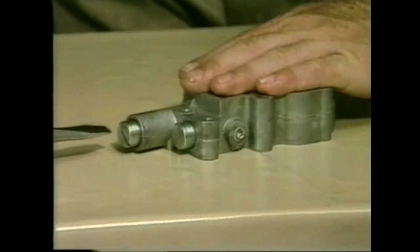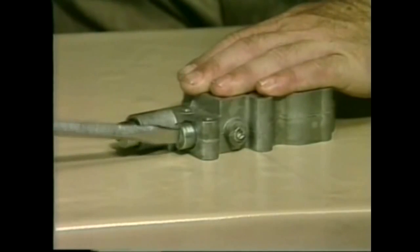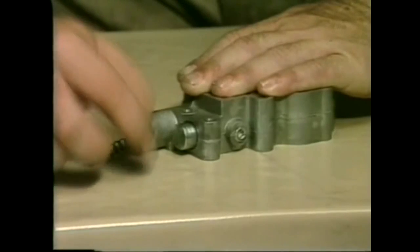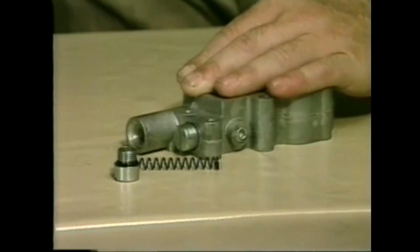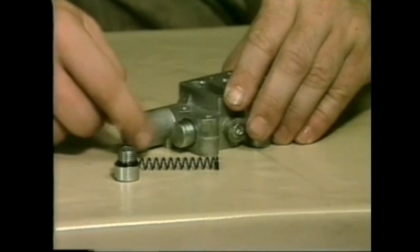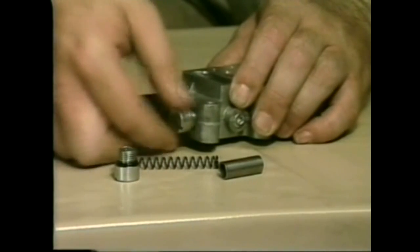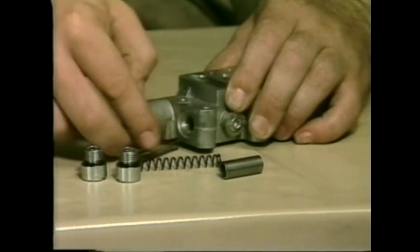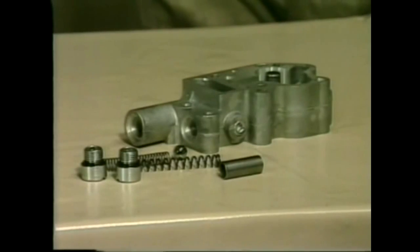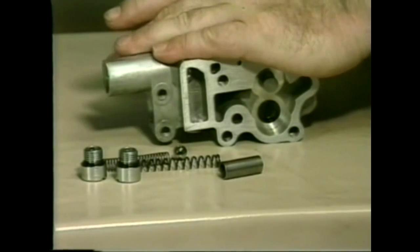Working now from inside the gear case and holding back this gear, we can push the main shaft of the oil pump through to expose a circlip at the end. This circlip holds the woodruff key in its keyway and holds the gear on the end of the shaft. Removing it with circlip pliers is a fiddly job — once removed, this circlip should be discarded. With the circlip removed, the main shaft can be pushed back through the gear and removed from the gear case. The next thing we need to do is dismantle the pump body. We use a large flat blade screwdriver to loosen the relief valve and check valve. The relief valve plug can now be removed by hand, revealing the spring inside. The relief valve plug has an O-ring which should be replaced. As well as pulling out the spring, we'll need to remove the plunger — more often than not the plunger will not be attached to the spring and some effort may be required to retrieve it. Next, we remove the check valve plug, which too has an O-ring that will need to be replaced. Remove the spring and then roll out the ball valve. This ball valve prevents the engine oil running back into the engine from the oil tank.